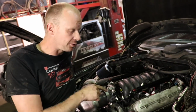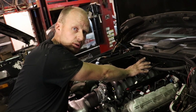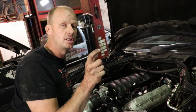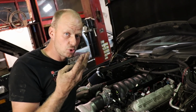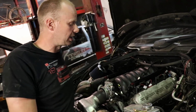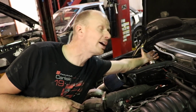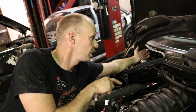If you have a front-mounted camshaft sensor, there's either a sensor at the back, that was the earlier generations, because we went with an LS7 camshaft, the drive is on the front of the cam. The cam wires are reversed. So to get a proper cam sync on a front mounted camshaft, you have to reverse the wires. Keep that in mind. If you are going naturally aspirated, your one bar MAP sensor is built into the actual ECU with this little blue vacuum line coming out.